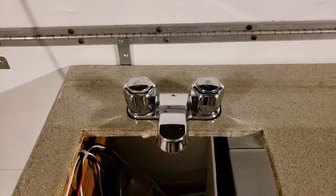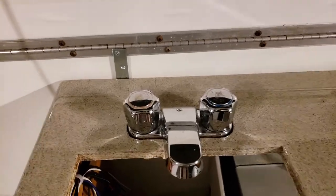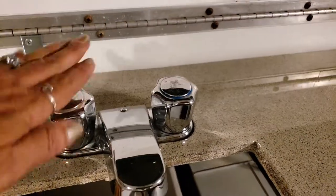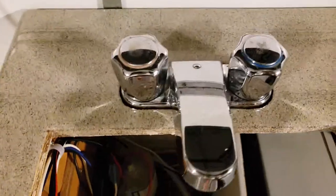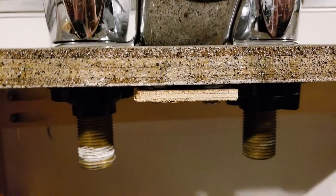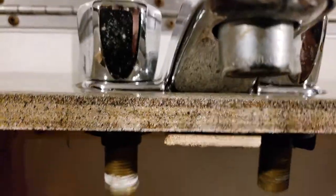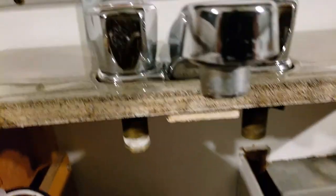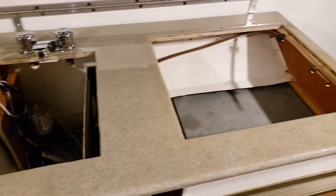This little nugget is actually a normal faucet. When I got the A-liner it was actually sitting on top of the counter, but it also caused sag because the hinge was bumping against it and pushing it down. So I decided to recess it — I cut the hole so that it would fit in there nicely, and then to space it and keep it in place I put this piece of wood as a holder. To keep the spacing the way I wanted it, there's actually a washer between here and here. So I thought it was kind of cute to have a normal faucet. Now all I gotta do is put the sink and the stove back into place.